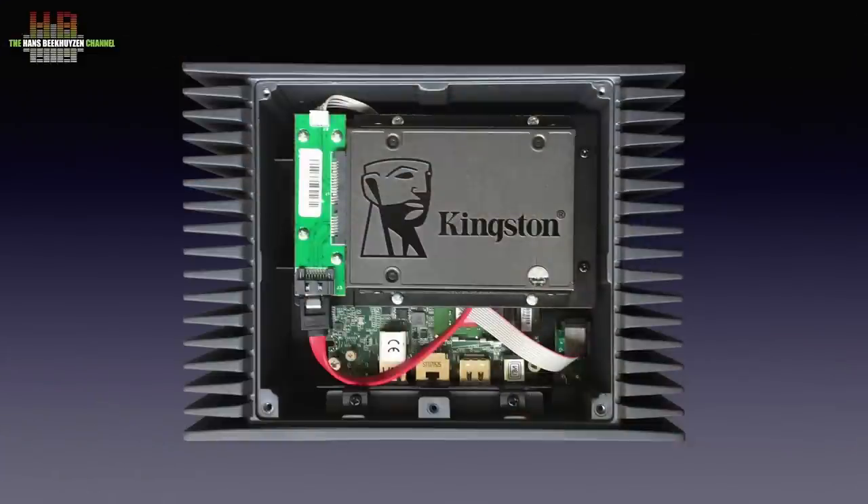When placed top-down, a thick metal plate can be removed by unscrewing 5 bolts. The review sample was fitted with a 220 gigabyte SSD for music storage. Far more storage can be mounted — up to 4 terabyte SSDs are available nowadays, but they come at 1,200 euros. You can also use a traditional hard disk; 9.5 mm thick drives are available up to 2 terabytes, and perhaps a 15 mm thick drive might just fit, available up to 5 terabytes at only 175 euros. But check first — I wasn't able to verify whether it will actually fit.